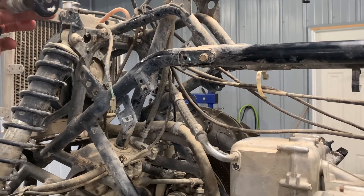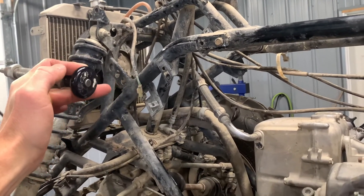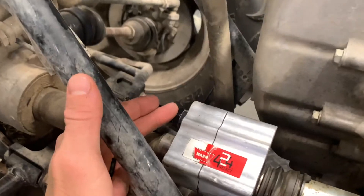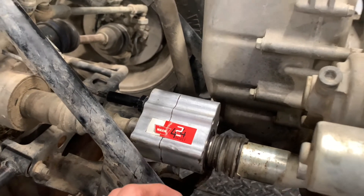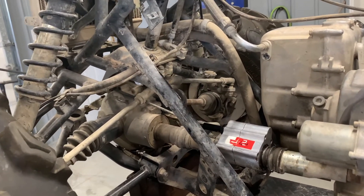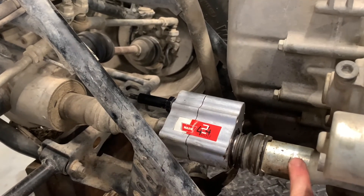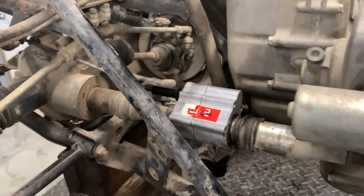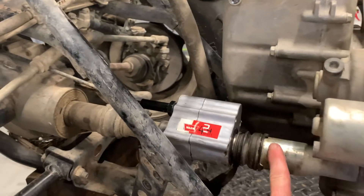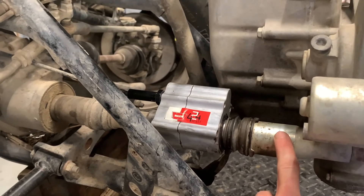They had a metal bracket welded onto the frame so there was no movement. You can push and pull this knob — that cable runs down into this housing, and you've got a shaft that runs through here. That shaft can be engaged and disengaged, which is what the pull knob does. This is the stock coupling on this side, and you've got a different shaft setup on the other side that fits into your Honda four-wheeler.